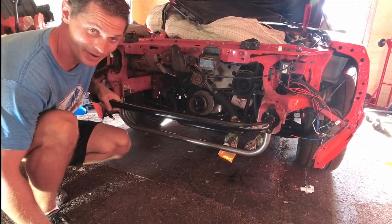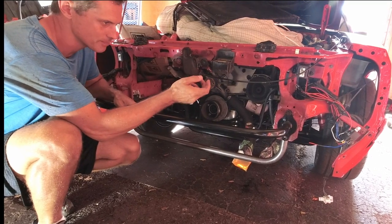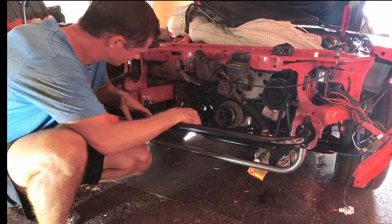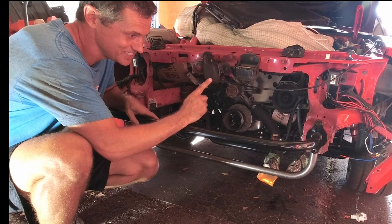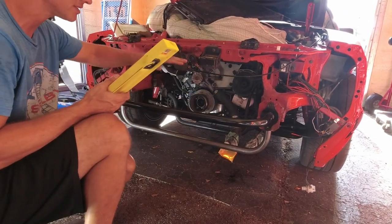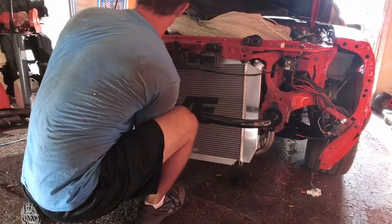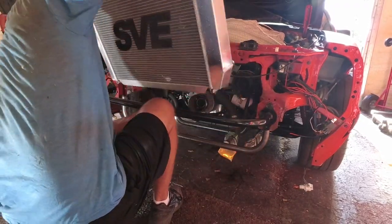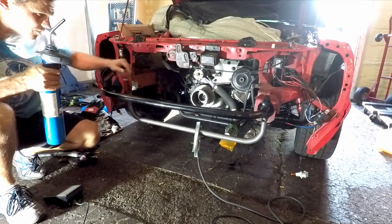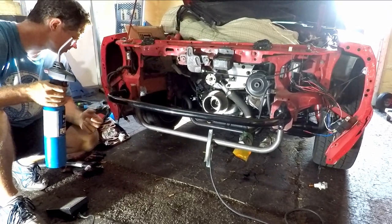It's a nice tight fit, and that way I know it doesn't move while I'm trying to weld it. It did have some holes on the sides of the bar itself that you could drill through the frame and bolt it in place and then weld it up, or maybe just leave it as a bolt-in. I opted to just make it a tighter fit, keep it in place, and just weld the whole thing up. I may just mock the radiator one more time before final welding just in case I haven't installed it quite the same as earlier — that would suck. All three of these tiers have the same angle, so that's a good start. I think we're good to go. I got my propane torch — I'm going to go ahead and heat up all the ends where I'm going to weld, not super heat up but just kind of warm them over, take the chill out of the metal, and then I should be able to start trying to weld it.